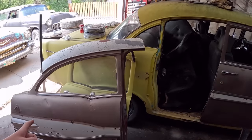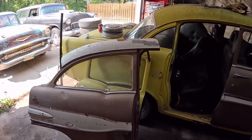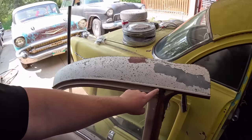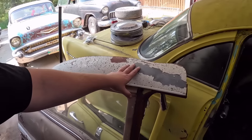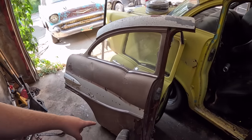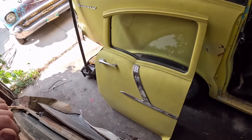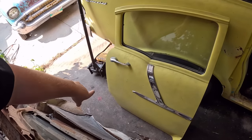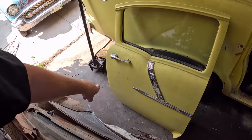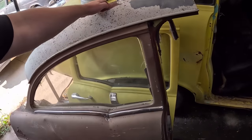So I think we're going to get set up, and I'm going to start cutting everything out of the backside. Get all that junk out. Then we have to, like I said, cut all in here out, get the roof section off. It's a good piece, but there's a lot of screwing around. And then as for the bottom panel, we'll probably cut that out. We'll just use the bottom of the door. Now, I know the front of the door is bent, don't worry. We have to use the back section anyways, because remember, we took the space out of the 6 inches here. So we'll use the back section, then we can move the trim over. We're all kind of taken care of.